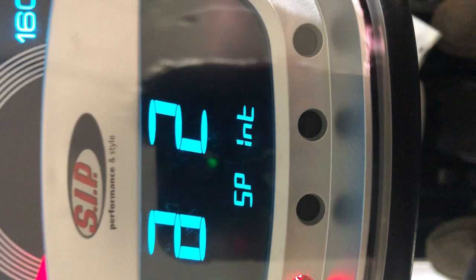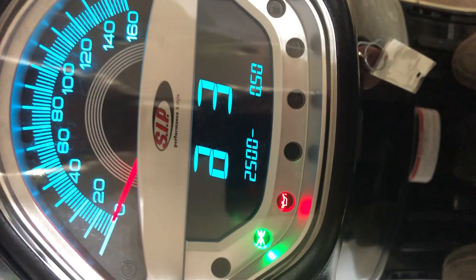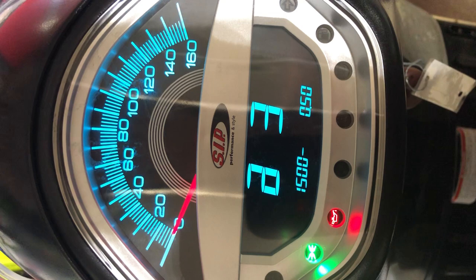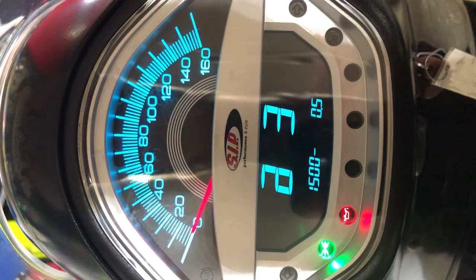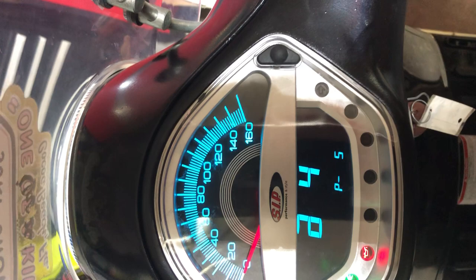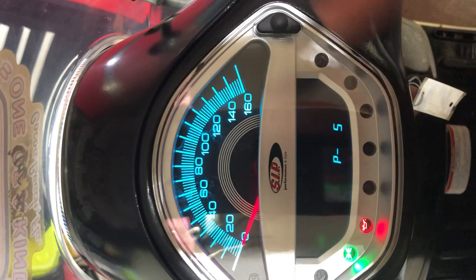This is the RPM — actually it's a wheel speed calibration. So if you have a different size wheel set up on your bike, or different years have different speedo drives, the manual covers that. This is where I had to play around to get the right RPM reading. I went with what the base average should be and set it — it now shows about 700 RPM at idle. I believe that to be correct.